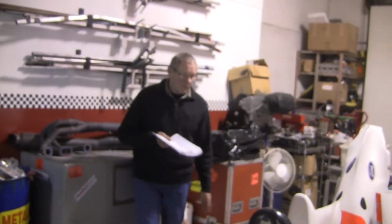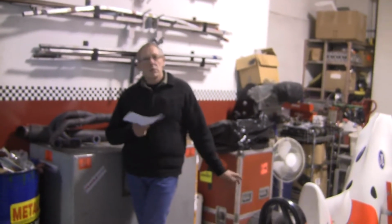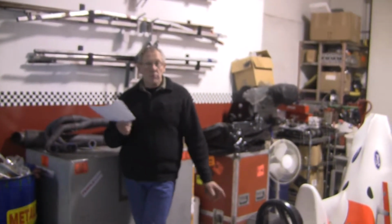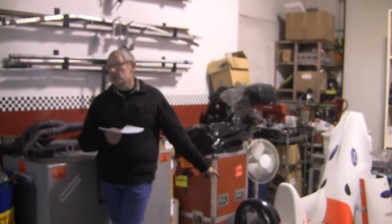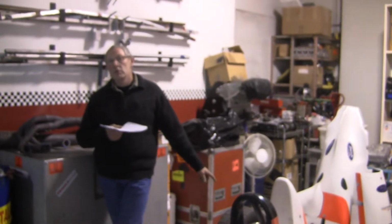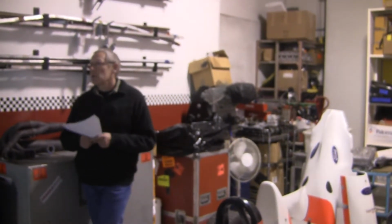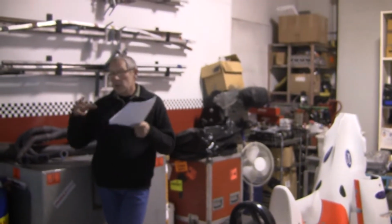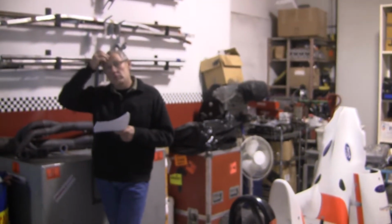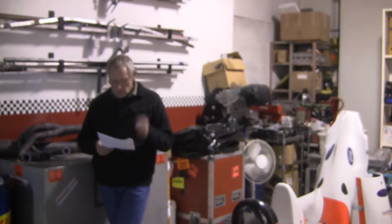And you can do the same with the rear. So once again, if it's got a very slight toe in, up to a mil or so, not the end of the world, but you sometimes find a car that's got 1 mil on that wheel and 4 mils out on this wheel, and that happens quite regularly. So quite often you'll have casters different in the rear of the car, especially with the older cars with fabricated uprights, and a lot of them are a bit bent and not perhaps quite geometrically correct. So okay,